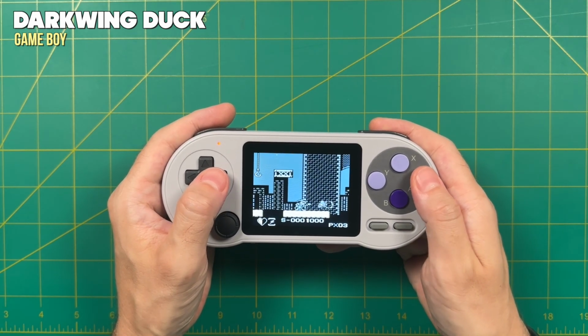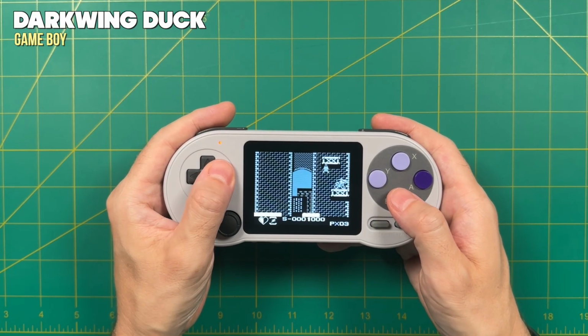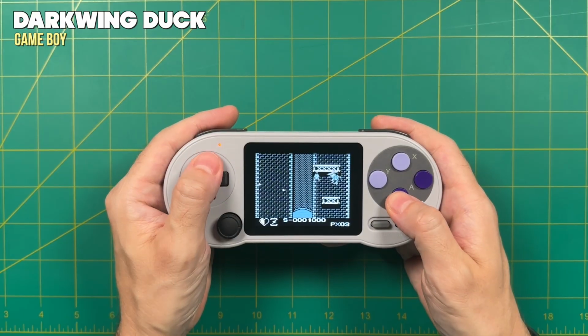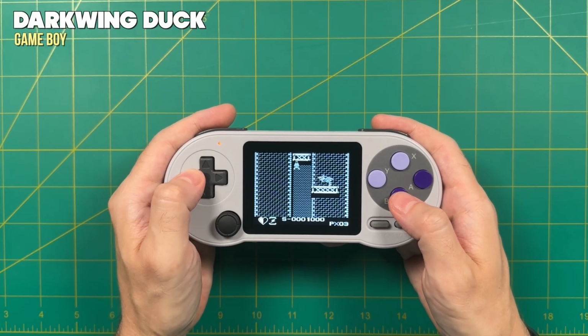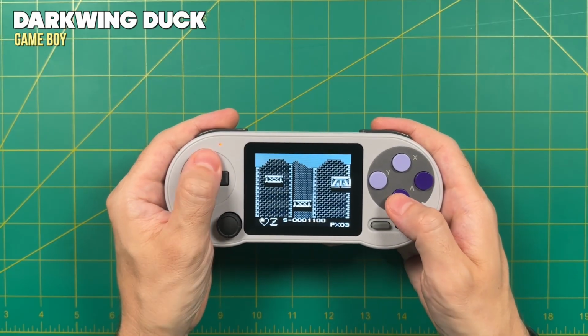The buttons definitely stopped bottoming out, but all the same, I felt like they could be just a little bit higher. And so in hindsight, instead of putting just 2 strips of tape, I probably should have put something like 4. Either way, I think you're probably trying to add about 0.5 millimeter of height altogether to the bottom of the button. Okay, next up are the select and start buttons.